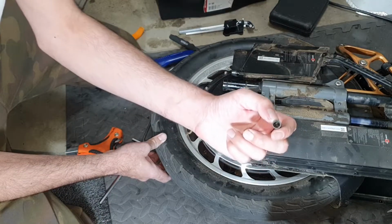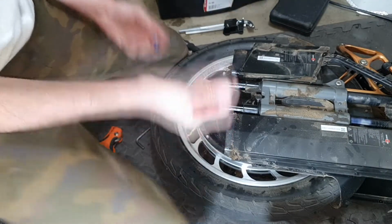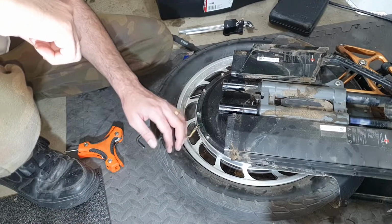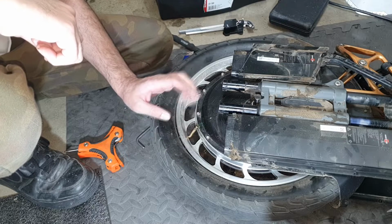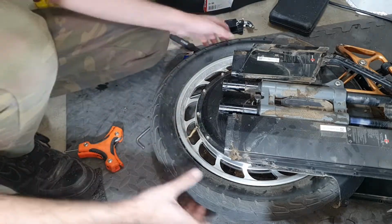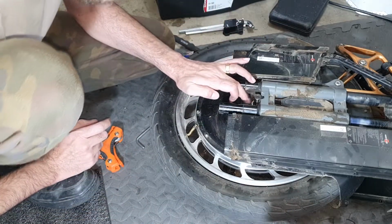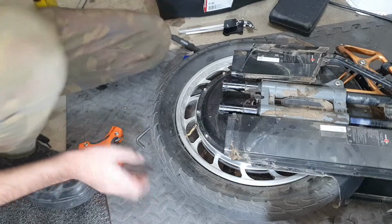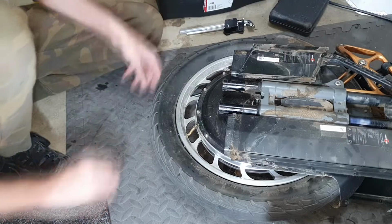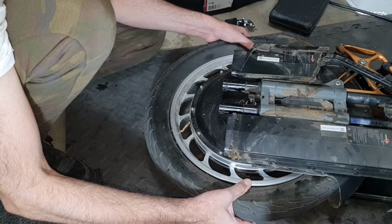Keep this safe, it's really handy. So keep the core safe for the new tube. Now I had this slime in my tube. This is a 2.5 years old tube and tire. Never punctured. Still the stock tube. Now, after deflating the tire, you just carefully pull the tire out. Clear the space. There's nothing obstructing. And slowly pull the tire out.